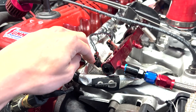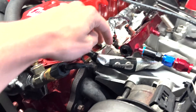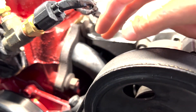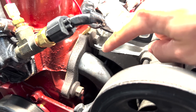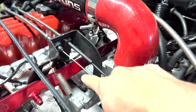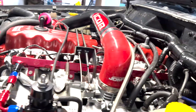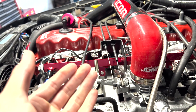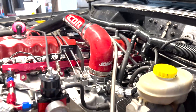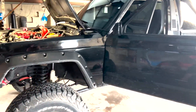You can see how much better the new fuel rail looks. You might think the heat sleeves are what's fixing it — they're not. I just have those on to protect my injectors because it gets extremely hot here. There are actually five spots on this Jeep where the exhaust is extremely close to everything. There are holes in the intake that give the exhaust a direct heat path to your fuel rail. This is an '86 Comanche; I 4-liter swapped it, then swapped in a 4.6-liter, and then turbocharged that.